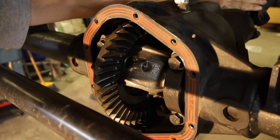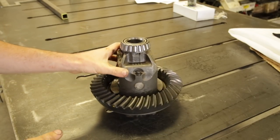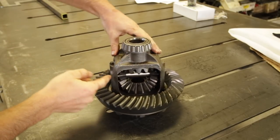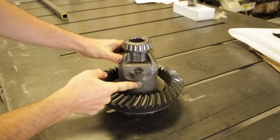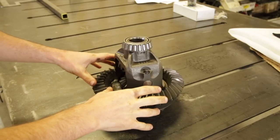There's another differential on the table here — this is the front differential from a Chevy 10 bolt. This is the pin, the retaining bolt right here that holds the pin in. That whole pin needs to slide out, but as you can see, this would clear the ring gear no problem, so you'd be able to do all this without taking any of this out.